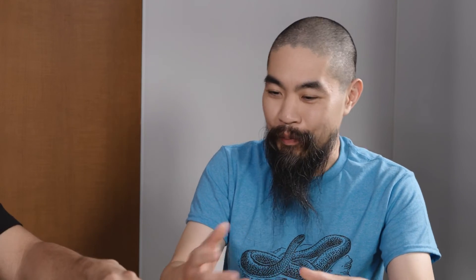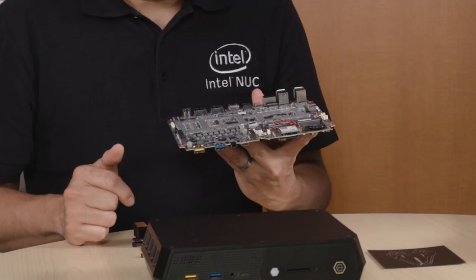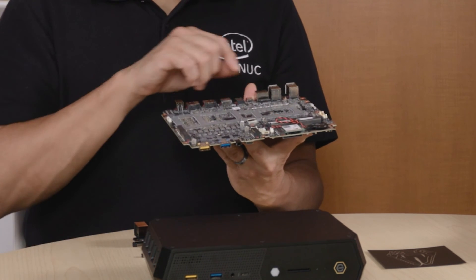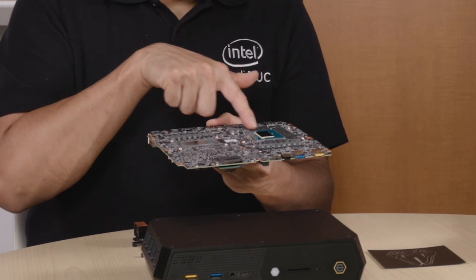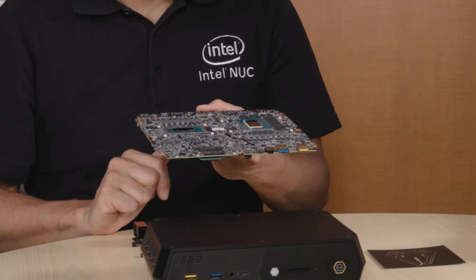While we've got the PCBA out, are there any other cool features to show? Over here, we've got the Wi-Fi card on an M.2 slot, which gives you the opportunity to upgrade your Wi-Fi card or remove it altogether for security purposes. On the back, again, we have the CPU, the GPU, and all the power delivery components. These squares here are the GDDR6 that supplies memory for the GPU graphics. That's a lot of technology packed into a small space — great integration and engineering. We're also going to have a teardown video, time-lapsed and sped up to show all the insides of Serpent Canyon. Thanks for joining Talking Tech.